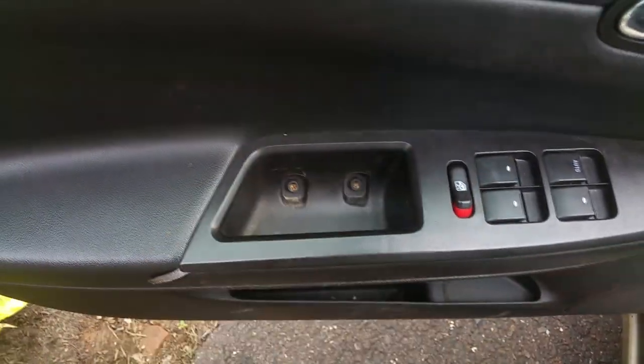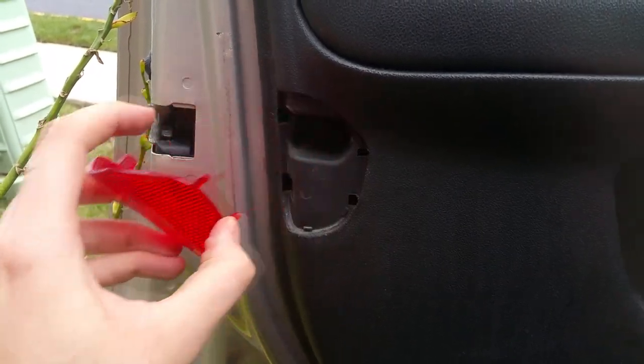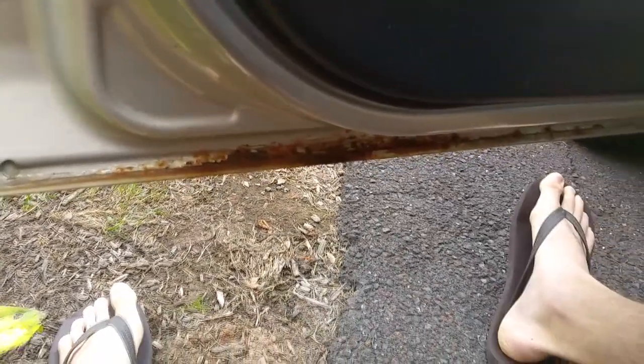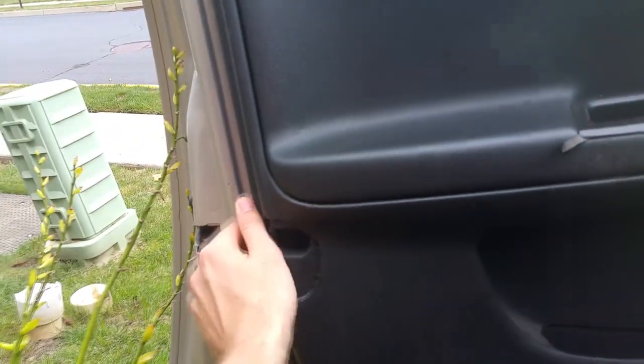You've got two more hidden under this rubber panel here — take those out. And finally, there's one regular hex bolt hidden under this reflector here. Then once you've got all those removed, you should be able to pry the door off — run your hand around so all the retaining pins pop out from the door frame. Then you should be able to lift the door frame up off the ledge.